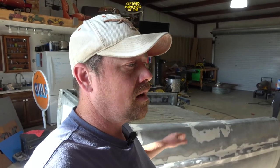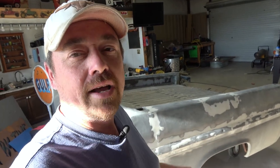It will go to shows, I'm sure, but it's more of a truck that anyone can touch. Even at the shows, kids can get on, whatever, it doesn't bother me. It doesn't need to be a perfect looking car. So keep that in mind when you look at the Bondo job that I did. By the way, I used 80 grit sandpaper to sand the Bondo down. Normally I would go back over it with like 200 or 300 or even 400 and get it even smoother. But like I said, it's just my everyday runaround truck whenever I get finished with it. So that's where it's at.